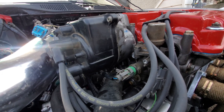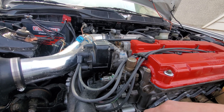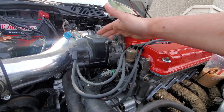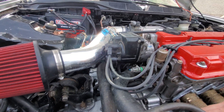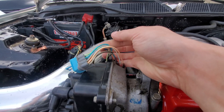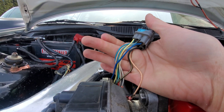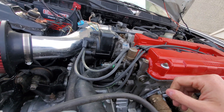It usually has that single blue wire. Just to get her running, I ran a wire from this plug over to the distributor and your tach will work perfectly — pretty straightforward. I cut that tab and ground it smooth. It works, got me running, got me driving — can be done. Any B series distributor should be the same. OBD2 you can buy harnesses for like 20 bucks to convert it, but super easy to do yourself — tons of pinouts online. It's basically one wire, the rest you're just matching up. Even though it's a 10-pin, there are only nine wires and that blue one is the only extra. Hope this helps!